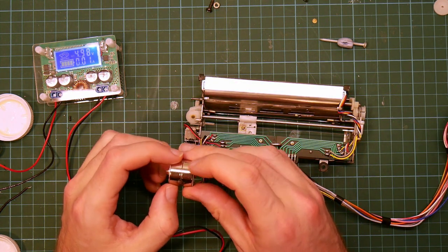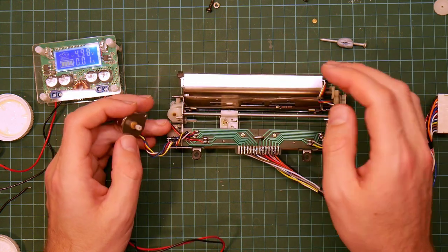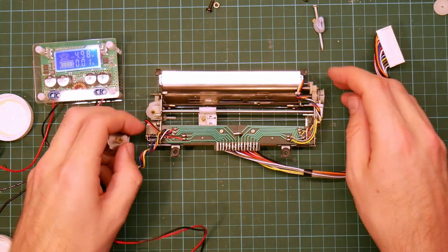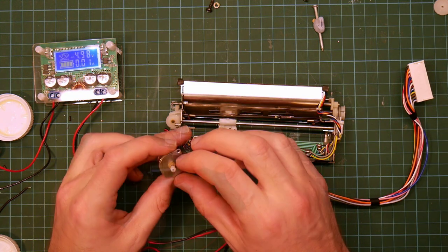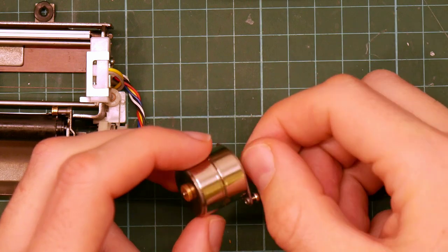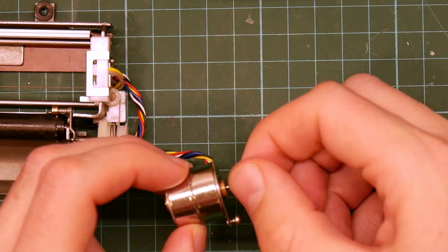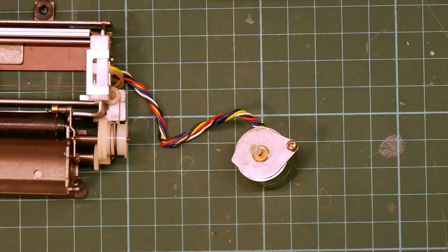If I can replace these motors with similar ones, then maybe I can get this thing working. More likely I will have to find a whole new plotter assembly and install it into the chassis. That shouldn't be too hard — these things do hit eBay, and many of them are broken because the spindle gears are dead. But I have two working gears here that I can pull off. More news: I took the X-axis motor off in order to try lubricating it, only to discover that it grates when it goes round. So this motor is basically dead — I think they've both failed, probably for the same reason. I am just going to have to get new motors or more realistically an entire new plotter mechanism. Damn. Still, it was 40 years old.